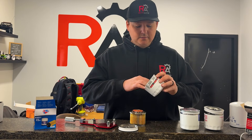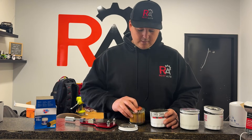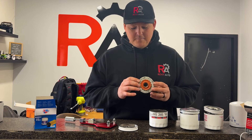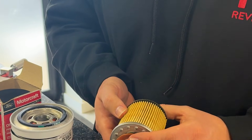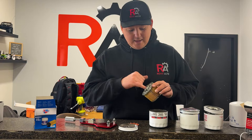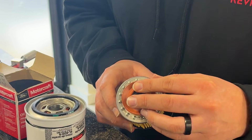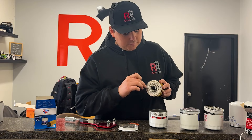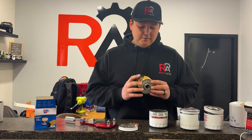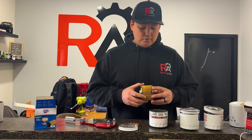This filter doesn't have a spring — it just has one of those stamped pieces that keeps it propped up. The bypass is not at the bottom; the bypass is at the top. I'm definitely not a fan of the gluing and I'm definitely not a fan of this pleating — this pleating is absolutely abysmal. But I am a fan of the fact that they put the bypass valve at the top, meaning if there was an issue, the oil would flow through the small holes, lift the bypass valve up, and flow out.